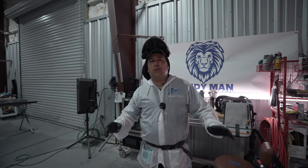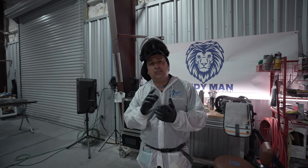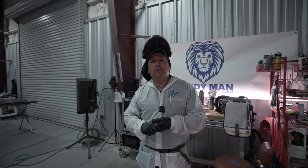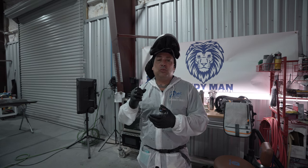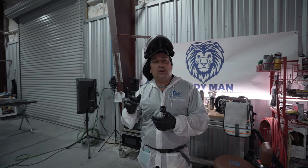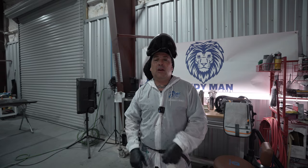All right, so that's all the ground coat. That's the coat with all the metallic in it, and you guys see that that color is transparent. So now we're gonna be moving into the candy. We are gonna be still using the LS because this is in the base coat. This isn't like the 46V where they put the actual candy concentrate in the clear coat. So to me, the 46V still pops a lot harder than this Tesla. So let's go ahead and get our candy on it.